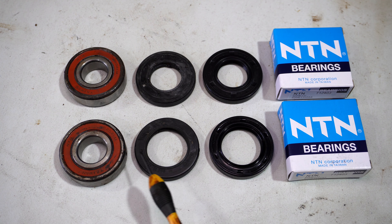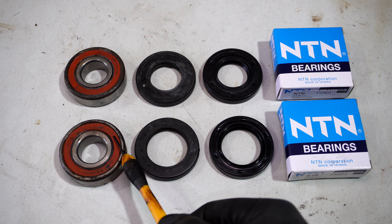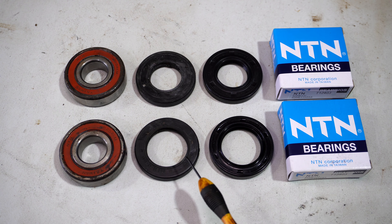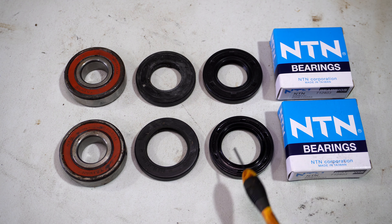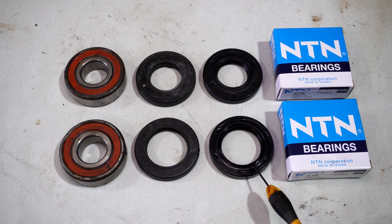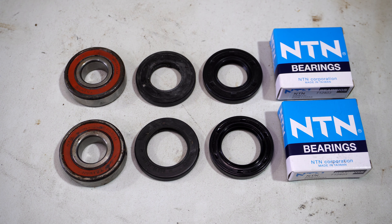I've just laid out my old bearings and seals. I looked online for replacements — about $55 Australian — but I couldn't tell if they were Chinese bearings; they certainly didn't say they were Japanese or high quality. So I've come back from my local bearing supplier where I picked up some original NTN replacement bearings and seals. I just gave them the numbers off the original bearing — 6204LU — which they matched up. The dust seals are measured by internal diameter, external diameter, and thickness: this one was 30-47-7 and this one was 25-47-7, all in millimetres.